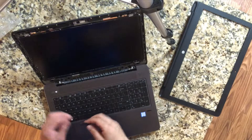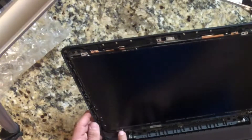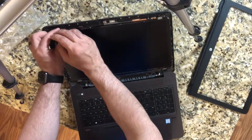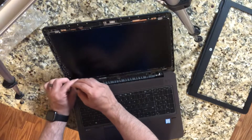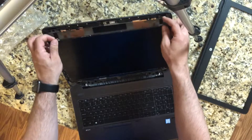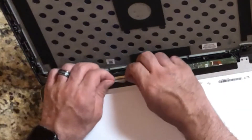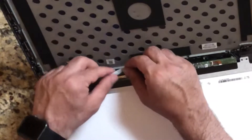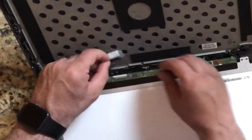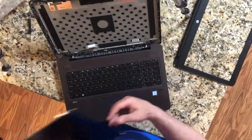I have a small Phillips screwdriver — about a 1.5 — you can also do this with a small flat head or a small knife to get into these little holes. There are four Phillips screws, two at the top and two at the bottom, that you need to remove to get the LCD free. Once you fold it down, you'll see the connection. We're going to fold this piece of tape back that covers it — it just helps hold it in place. There's a little flap and you just pull the connector out; it's really simple.